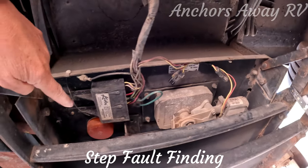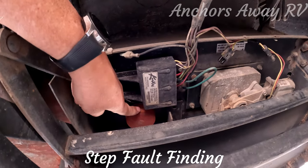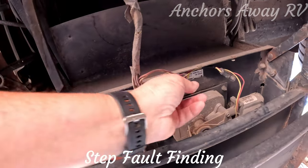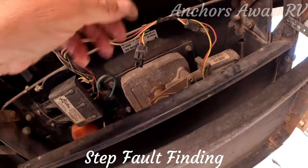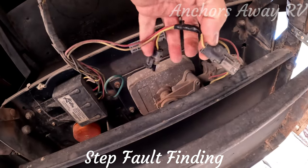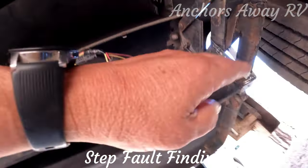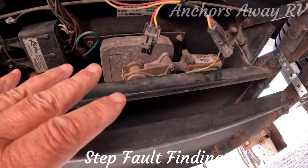I've already pulled all the plugs so I know I'm going to be safe. Just so you know what's going on: I've already checked the power — we are getting power because there's a light up in here, and when you turn the override switch on that lights up. But I haven't checked all the other power coming in yet. As you can see, I've disconnected the motor from the loom and taped it up. Normally those two plugs go together — this is the motor here.